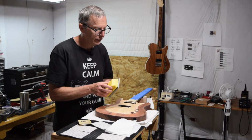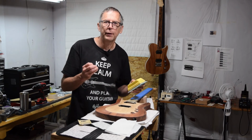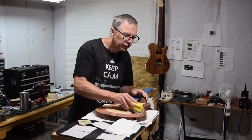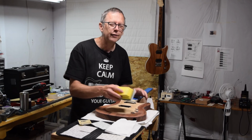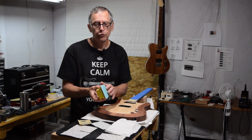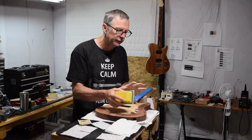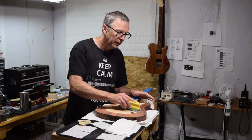Another thing to consider is as you're sanding, you may notice some scratches in the surface that appear to be more pronounced than the surrounding area. If that happens, just work those areas a little bit longer until you see those scratches fade away. If they don't fade away, you may have to back down to a coarser grit to take care of those, but just work that area. And then once those scratches have disappeared, you can just work your way back up through your grits.